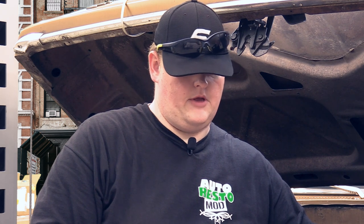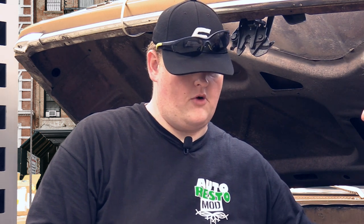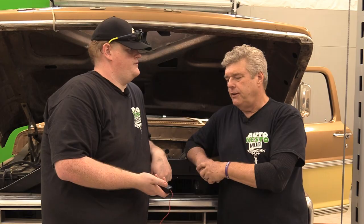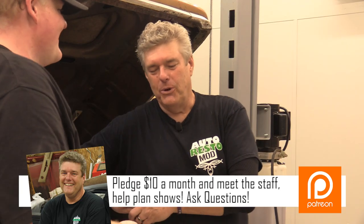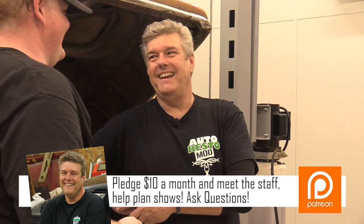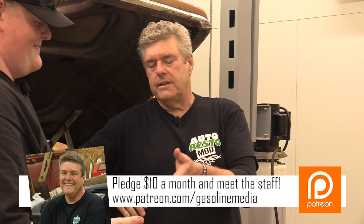It is tailored to Ford — this is really only going to work on Ford products. GM uses different ohms, and most other manufacturers use different ohm profiles. Ford old stuff uses zero to 100 ohms. If you don't know if the fuel system is working in this truck, you can find out if it's the sender. You can be really sure — if somebody sold you a car with a tank empty of gas, with this thing you'll know whether the gauge works on full or empty. It's just a nice little tool.